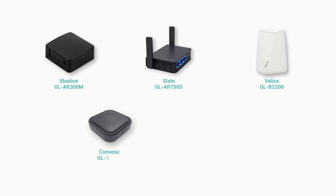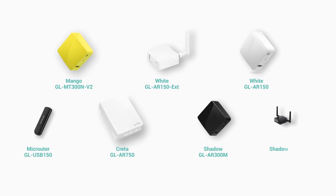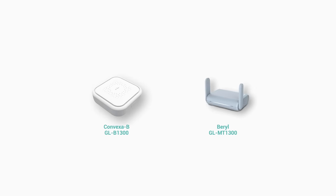During the firmware flash process, the LED will continuously flash to indicate that it is writing firmware to the flash. Please wait patiently until the router boots normally. Routers with NAND firmware or eMMC generally take around 1 to 2 minutes to finish. Mini routers with 16MB NOR flash take about 3 to 5 minutes to finish, while B1300 and MT1300 have 32MB NOR flash and take much longer. Please never power off your device during the firmware flashing process — please wait until the router's LED starts working normally.